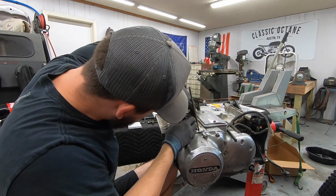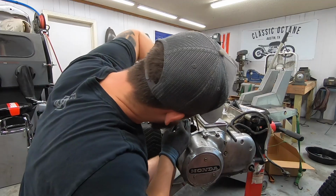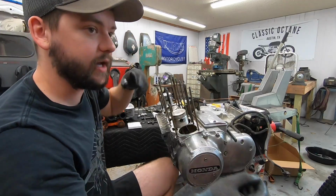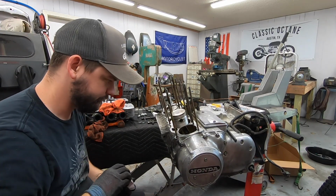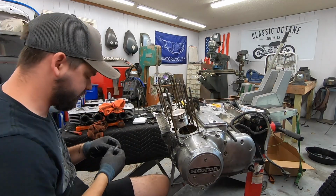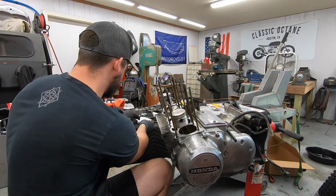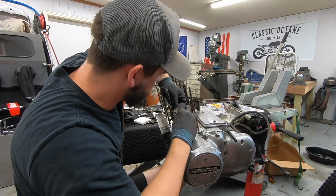Like that. We'll find the gap on this corrugated piece, which is right here. And it's out. You can pull the pistons out to do this if you want. I'm just going to do it with them on the connecting rod still, just so that it helps support it. So when we're going back on, we're going to do the oil control ring first.